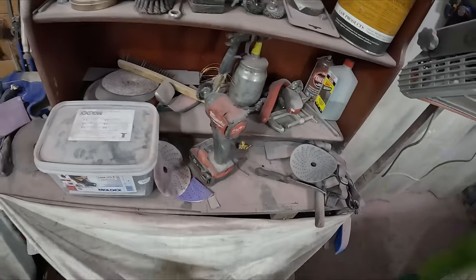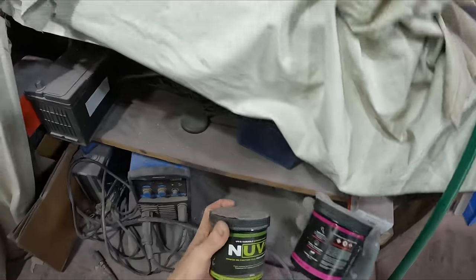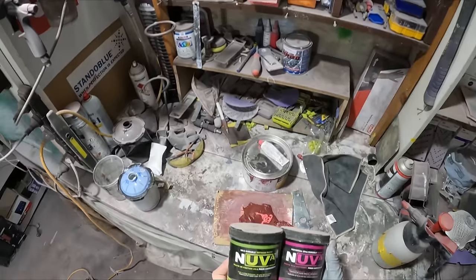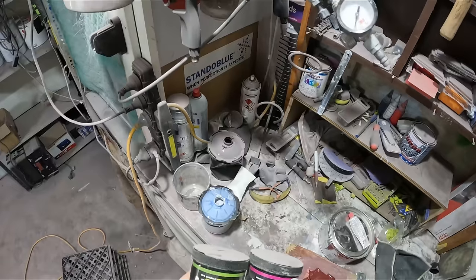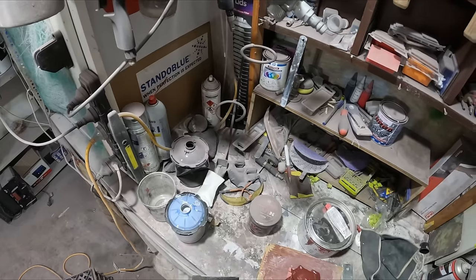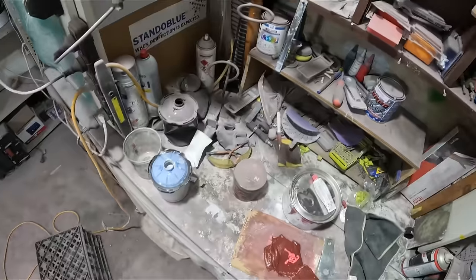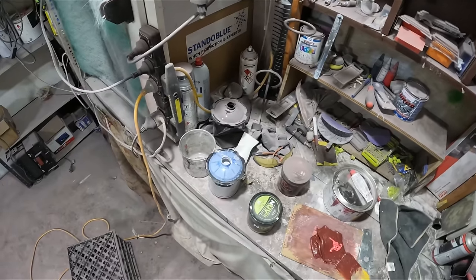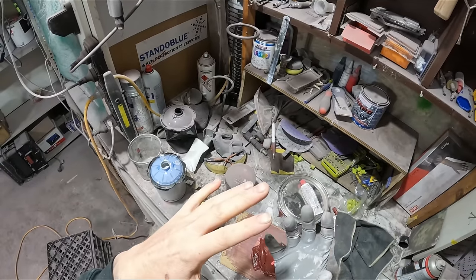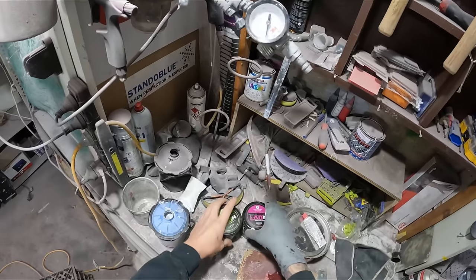The regulars of the channel will know that I'm actually a big fan of the UV fillers, but I just don't think that this is the right job for it. This stuff doesn't shrink, right — it won't shrink back — it's totally different technology. But the way I'm seeing it is because the two-pack will shrink and the UV won't shrink, that could lead to some kind of issue. As the two-pack shrinks around it, it stays still, so it kind of in effect does shrink — but it's the two-pack shrinking.